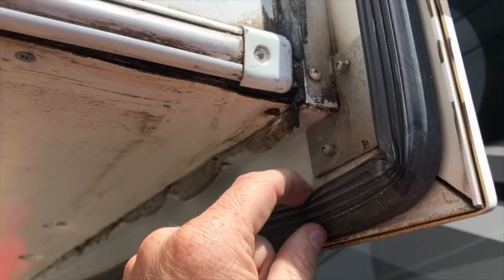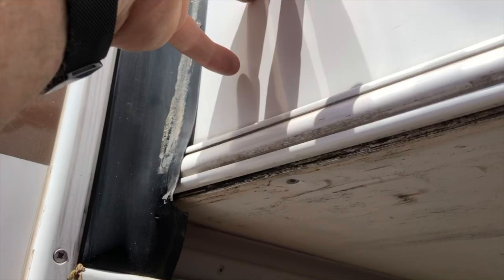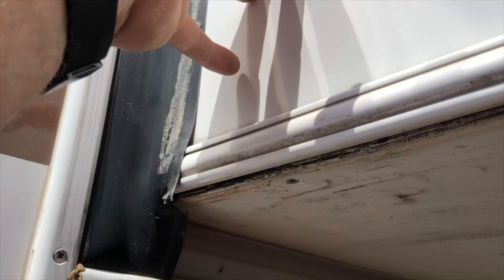Simple silicone, insert moldings, and cleaning — then treating the bulb seals, making sure they're soft and protected from the sun and water — will prevent them from tearing and drying out. It also decreases the stress when the rooms run in and out, so it's not struggling like a dry wiper blade skipping on a windshield. Thank you so much for watching 'What's in the Shop.' Please hit the subscribe button to see our next episode.